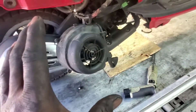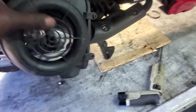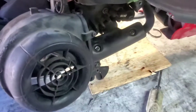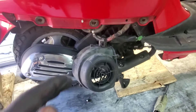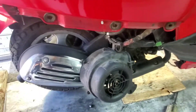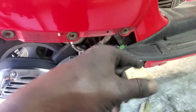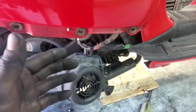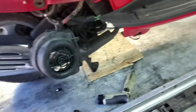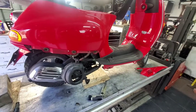And then the last problem that your scooter had — I'll include a photo to show you underneath your flywheel here. The magnetic pickup on the flywheel was completely rusted away. And as a result, the magnetic pickup couldn't send a signal to the engine to spark on time. And therefore, the bike would go da-da-da-da-da-da-da-da.